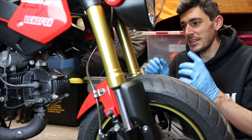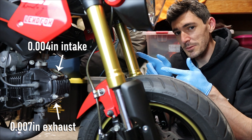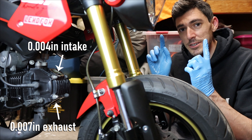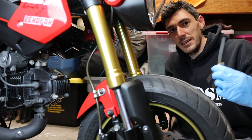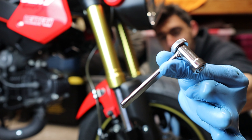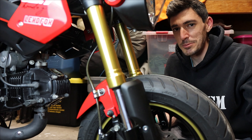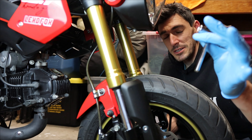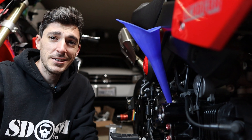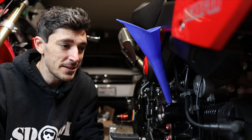The values I'm going for are not necessarily the ones you'll be going for, because I don't have a stock cam. If you do have a stock cam, those are the values you'll look for on intake and exhaust. In my case I have a DHM cam, so my values will be different — and I'll do that right now with my feeler gauge and valve adjustment tool. This is a specialty tool I highly recommend; you could use a wrench and pliers but this makes it much easier and more precise. I'll drop an affiliate link below. Valve check done — I didn't have to make any adjustments at all. That's the nature of Hondas. Now we put oil in to finish the oil change.